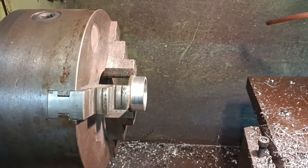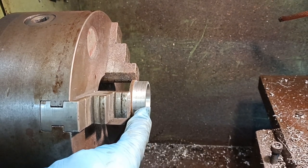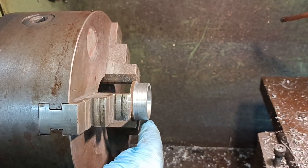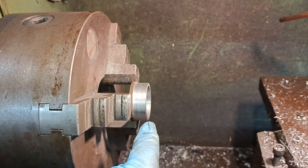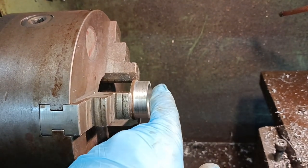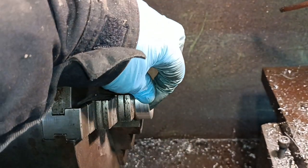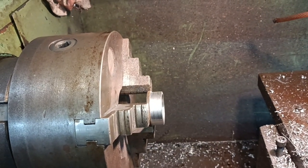So what I've just done in the lathe, good old lathe, I got this piece of tubing, heavy wall tubing, and I'd only got that much. I've skimmed the OD and I've bored the inner diameter. So the inner diameter and the outer diameter are concentric. So what I'm going to do now is take it out. I'm going to cut it into three pieces, so I can insert one piece in the bore by each cat's paw, and the wall thickness will be equal at any of the three points. So it should serve to centre up the boring tool.